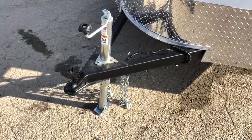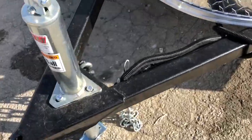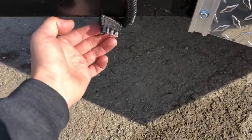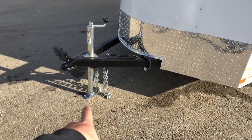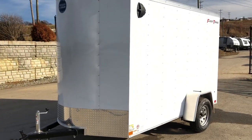As with most single axle trailers, a 2 inch ball is standard. Also notice instead of a regular painted jack, it's a zinc coated jack. You've got a standard 4 pin wire harness and loom — 4 flat would be your connection. Of course your safety chains, and notice at the bottom of the foot you've got a little sand foot there. Front stone guard, all standard.